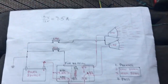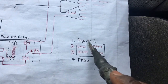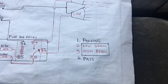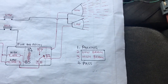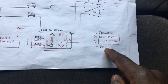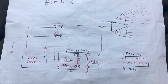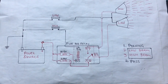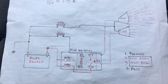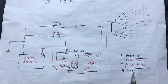For the sake of simplifying this demonstration, the combination switch here has four functions: the parking function, the low beam function, the high beam function, and the pass function. The pass function is whereby you're driving on the highway and you want to move to the other lane with oncoming traffic coming from the opposite side. This pass function is a momentary function — you momentarily pull the combination switch and the high beam blinks at the oncoming traffic to communicate to that driver that you want to pass. They then allow you to pass.